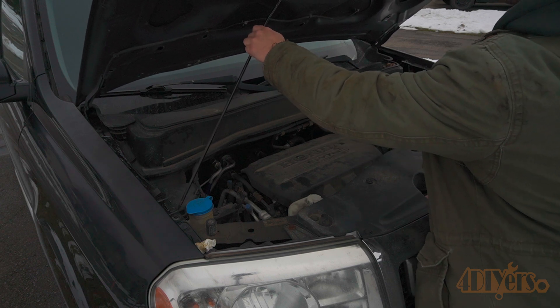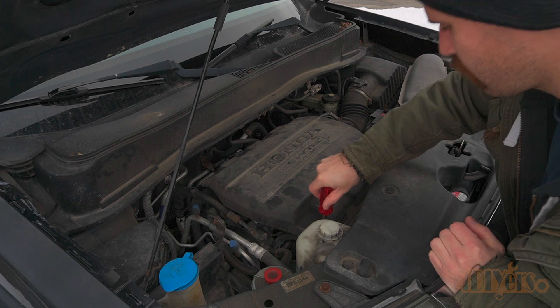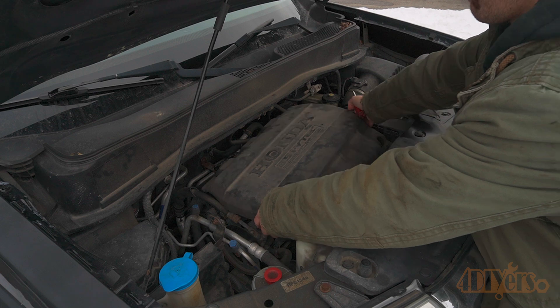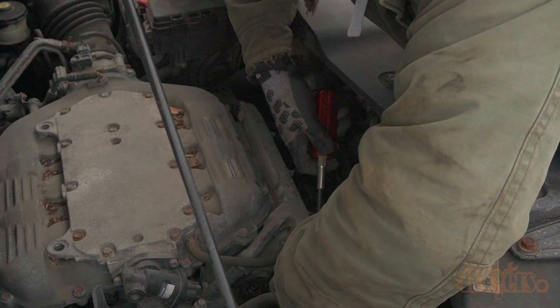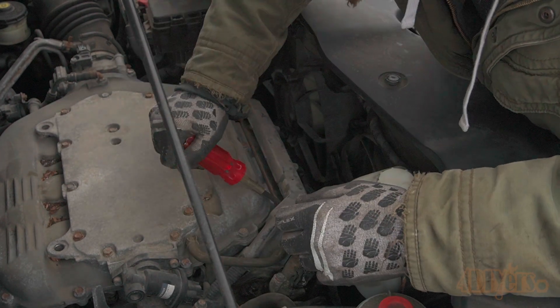Start by opening the hood and make sure the engine is cooler. Using a standard screwdriver, turn the clips on the front of the engine cover about a quarter turn counterclockwise, then lift out the engine cover. Use the standard screwdriver to disconnect the clips on the wiring harness and lift it up slightly — this will give you a little extra room for pulling out the solenoid.